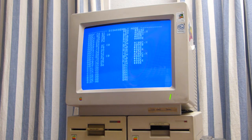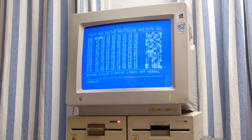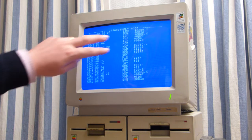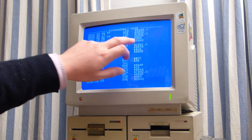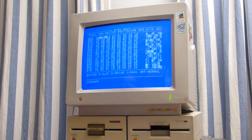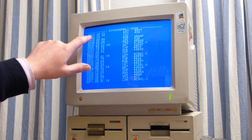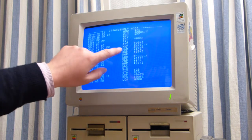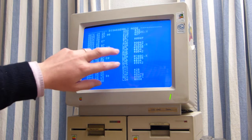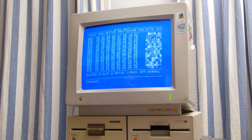And we'll look a little bit below. Everything is standard here. We'll go to the next sector and see that the final markers are checked here. Compare DA, compare AA. We should have seen compare DE, compare AA. So we'll change at offset 35. What else? We have here the routine at 944 to read the header field. And then it has a comparison with compare DA, compare AA, where we should see compare DE, compare AA, at offset 91.